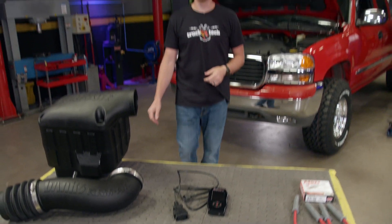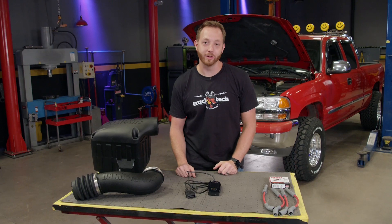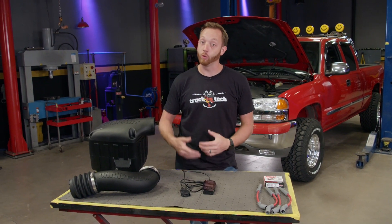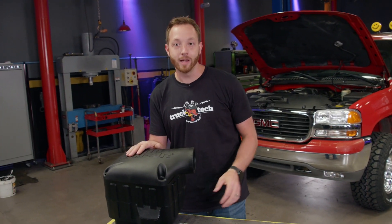You can sort of think of our GMC as a bit of a budget build. You haven't seen us throw on any mega-dollar forged 22-inch wheels, coil-over suspension conversions, or anything like that. Most of the parts that we have are reasonably affordable, and the same is going to hold true for the parts that increase the performance. There are three main ways which you can increase the horsepower of your truck without spending a ton of money. The first we've already taken care of — we did long tube headers and a free-flowing exhaust a couple weeks back. Today, we're going to take care of the remaining two: intake and calibration.